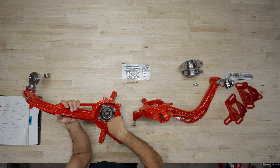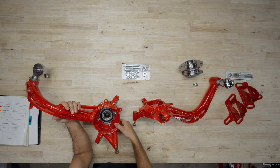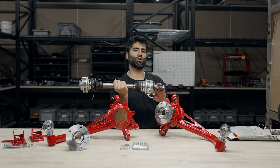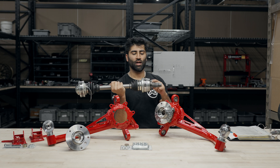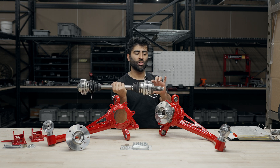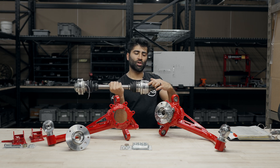You can see that the bolts are recessed and give you ample room for the E36 M3 style axle. Because these use the BMW M3 axle, you get the benefit of running higher horsepower as well as the larger spline. The only thing you do have to modify is the vehicle speed sensor ring — you have to slide it all the way back until it stops.